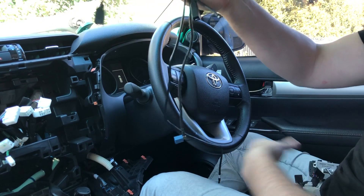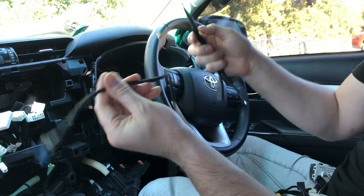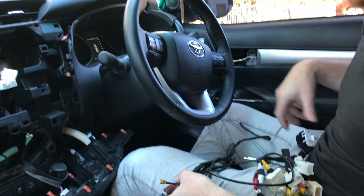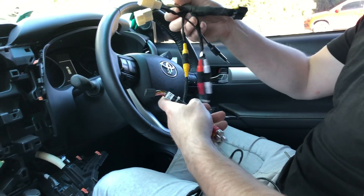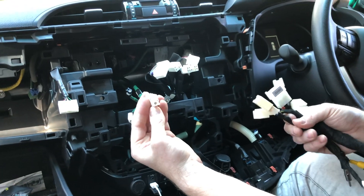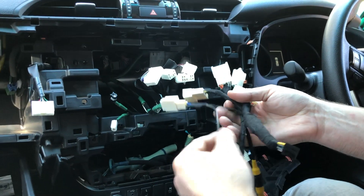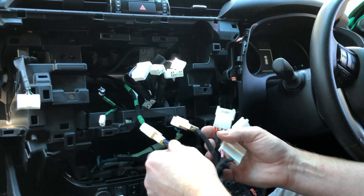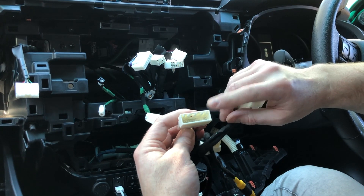The kit comes with a couple of other cables that are separate — an additional USB and a couple of adapters for the factory antennas. The small square plug is the radio antenna — that's just for your normal AM/FM radio; it does not do DAB+ radio. The 28-pin Toyota plug retains your steering wheel controls, reverse trigger signal, and vehicle speed sense. On top of that, the 24-pin plug is for your factory reverse camera — all wired up to retain that.